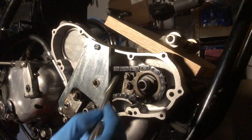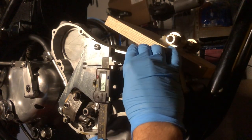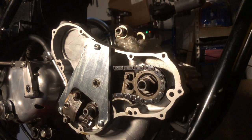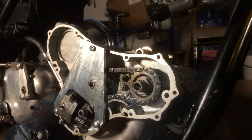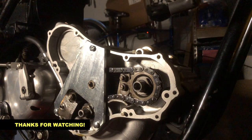I can tell that we do need to make some adjustments here. I definitely like that — at least at that point in the chain. What we want to do is confirm it in several places. We've definitely got a tight spot right there. Checked in a couple of different spots. The last thing to do is tighten up the tensioner nuts — I believe 15 foot-pounds.